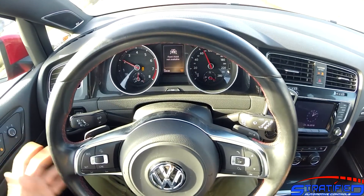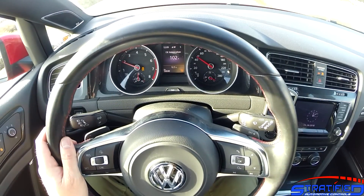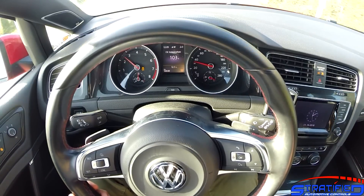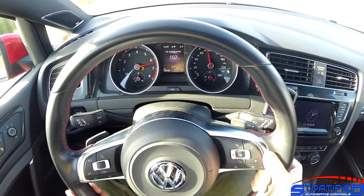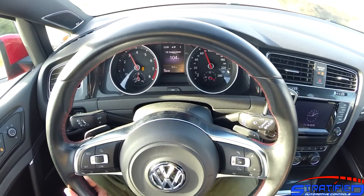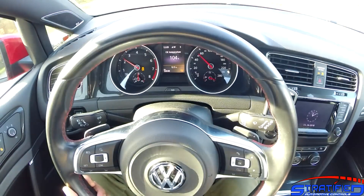We're going to demonstrate now with the Cobb system tuned by us to our specs. Watch the tachometer and listen to how the engine and the car sound. We're going to get into second gear — a gear that usually slips quite a bit — and just accelerate. You saw there was a loss of traction and the Cobb-based traction control system kicked in, allowed me to regain traction. There was a loss of traction again and then it allowed me to finally regain traction and make the best of the situation.